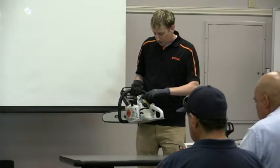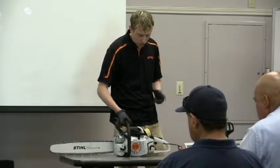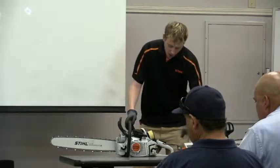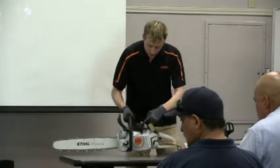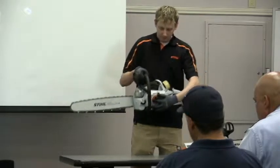That's pretty much it for the interior. When you put it back, make sure you get a nice good seal — you don't want to over-tighten it, but if it's not snug, you're going to have dirt inside the engine. And on the cooling fins, remember to keep those clean. Blow them out regularly — it's very important.